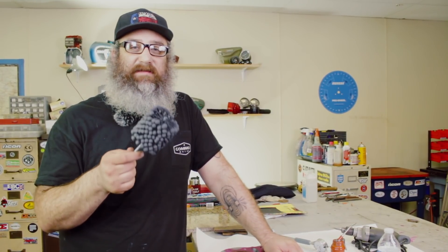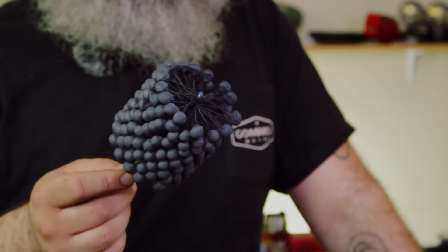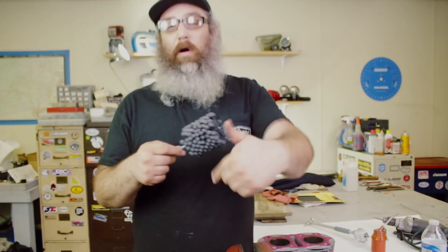This is what we're going to be using to hone the cylinders. This is called a flex hone, or a dingle ball hone, or a ball hone — all kinds of names for these things. Basically it's like a brush with little blobs of silicon carbide on them; they're going to flex as this goes into the cylinder. You have to make sure to buy the correct diameter for your cylinders and also the right grit for the cast iron liners — we have links in the comments for that part. We're going to oil this up with some regular motor oil to keep it lubricated. The whole process goes pretty quick, about 30 seconds per cylinder. It's a fast, aggressive, kind of noisy process, but once it's done it yields beautiful results.